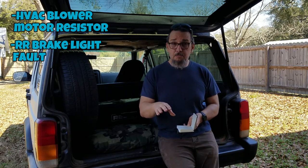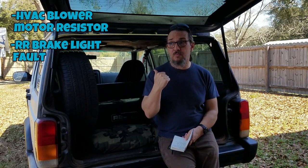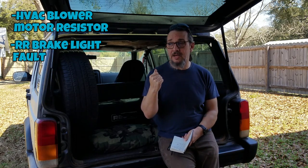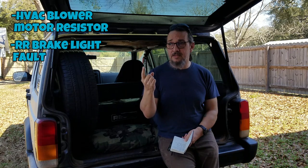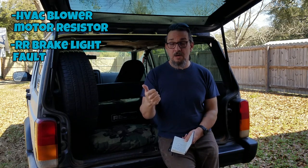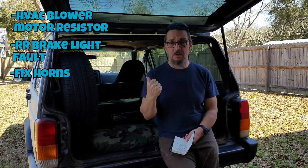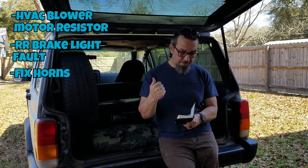When we did our clock spring replacement video for the Jeep, we did that because we had an ABS light, no cruise control, and no horns. All those things run through the clock spring. When we replaced it, we got our ABS light to go out, we got our cruise control back, but we still had no horns. So I'm going to go ahead and troubleshoot the horns, and we'll get those fixed.